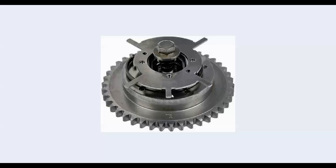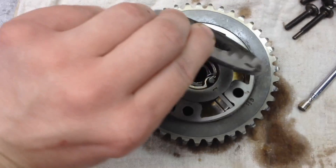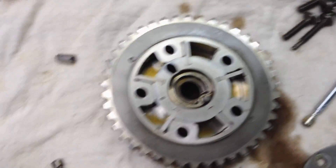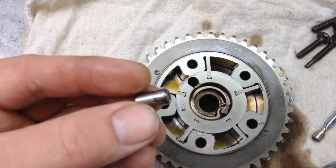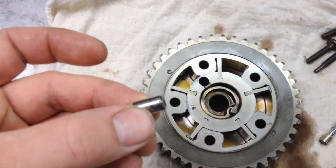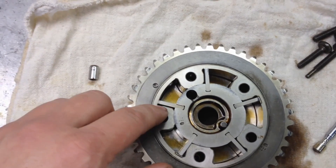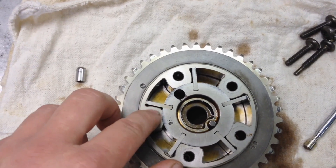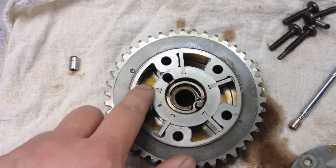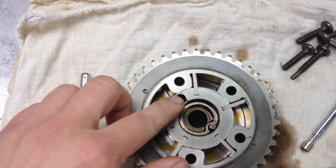It's an easy visual check once that valve cover is off. I want to show you the inside here — this backing plate comes off, it actually holds all the pressure, just a couple screws. Here's the actual plunger and spring, and this is that little locking pin. Let's see — it's a little worn out, but this one wasn't bad as far as noise goes. It goes right into that little hole right there and holds it at base timing when there's no oil pressure. When oil pressure is present, it lifts off and the spring forces it back down on return, but with oil pressure the VCT starts activating.